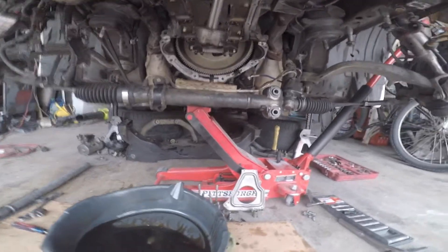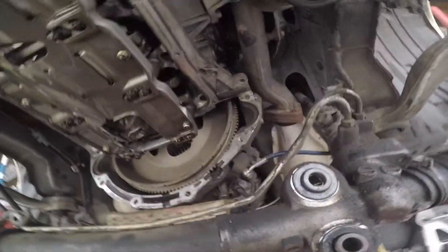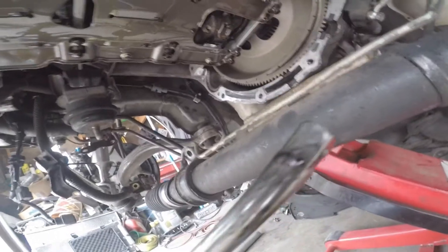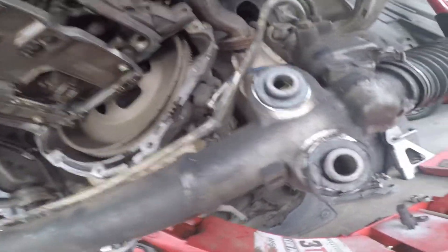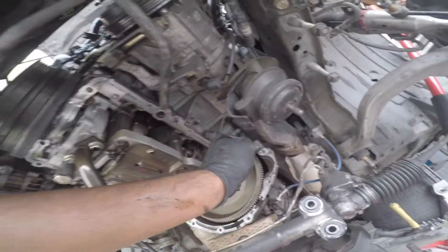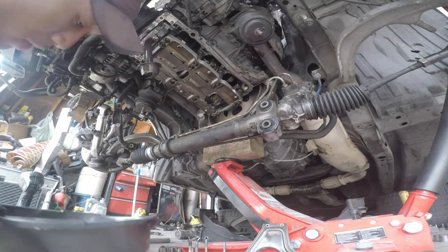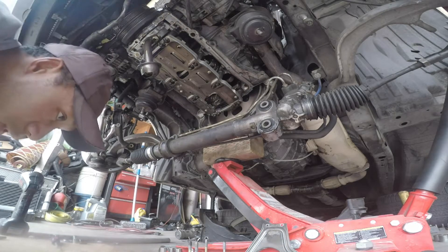I was not recording that whole process, sorry. But I finally found the point where I can get this guy out. So if your lower oil pan is on, just stick something in there — I stuck a 3/8 ratchet extension bar in and pried it from out and in. It came off nice and smoothly, a lot easier than trying to pry up on points up here. So right now I'm in the process of trying to figure out if it is a rod bearing or not — kind of hoping it is, so I can at least get through this motor for maybe a year or something.